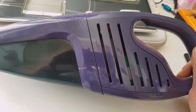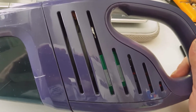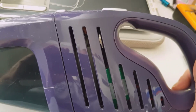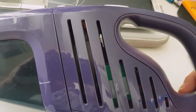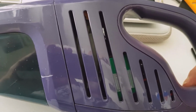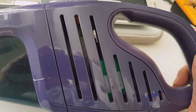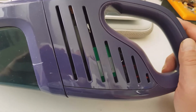Now, what will this do to your vac? It will probably void the warranty, yes, definitely. And secondly, it will make it a little bit noisier. Now, someone will say, yeah, but it still retains particles that the primary filter will not. Okay, the primary filter clogs about once every 2-3 days and needs a good cleaning, the way we use it. This one took about 6 months to clog. So you can see the ratio of particles retained by the primary filter with respect to the secondary. The secondary filter does not really play a tremendous role in cleaning the exhaust air, but it restricts the exhaust airflow. So it's a very simple fix.